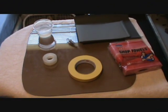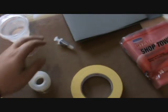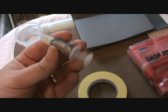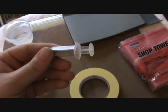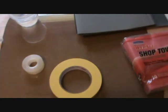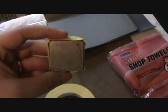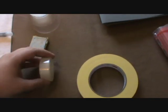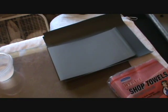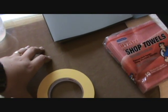For your lapping materials, you're going to need some water. You're going to have to have thermal compound for when you put the stuff back together — we're using OCZ Freeze. You're going to have your masking tape, which I use for protecting the processor — the part we don't want to screw up. You're going to have your scotch tape for taping your sandpaper to your glass surface, which is the cheapest, flattest surface you can get.